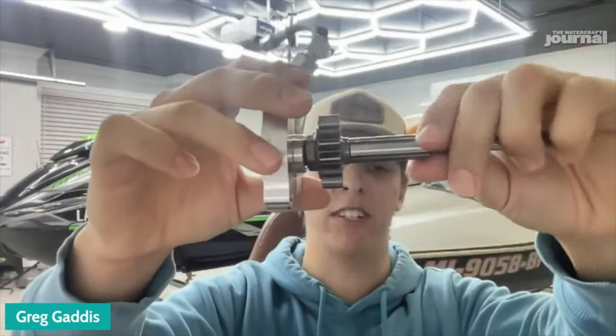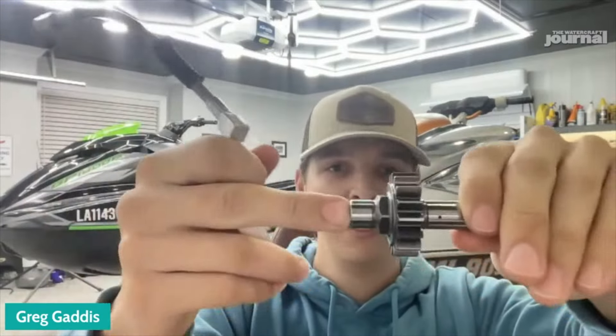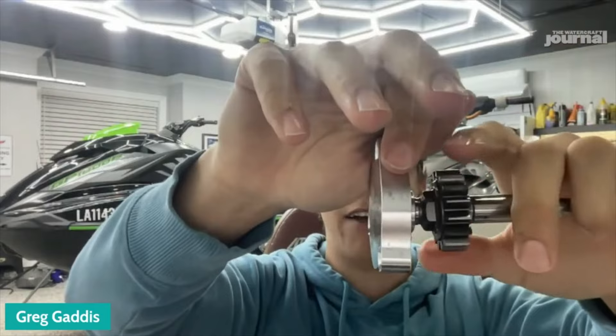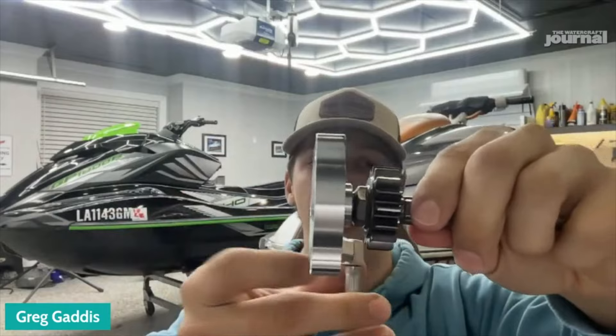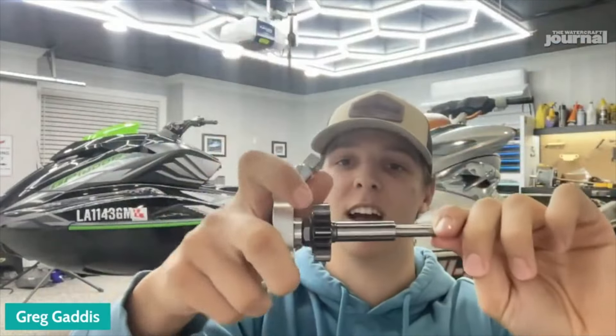So that's the issue — it's not that the shaft design is bad; it's just that oil pressure needs to be there for it to work well. On top of that, the Reva shaft has this billet aluminum plate — this is not a factory part. It's adding more oil to your supercharger because it's dependent on it, plus an additional support bearing. The rear of the shaft is actually supported with this. Some of you may remember back in the day these gears would just break off because there was no rear support. When you support the rear gear like this, you're adding more overall support to the shaft — the gear can't break off like they did in the past — and you're adding more oil via an additional bearing coming up through the shaft. This is a fantastic design; Reva did an excellent job. For 99% of people, this is the best shaft you can have.